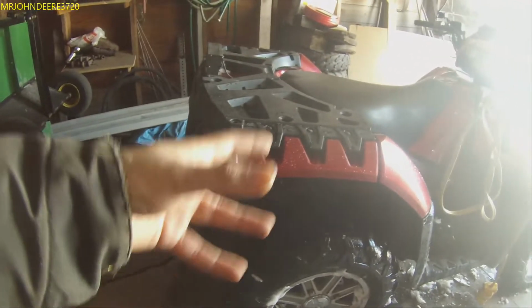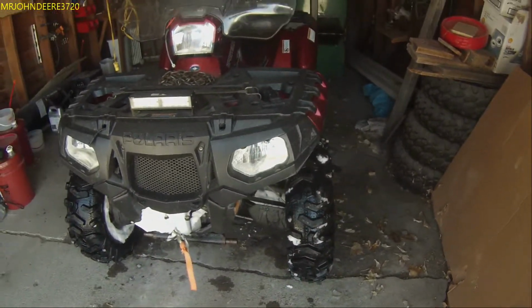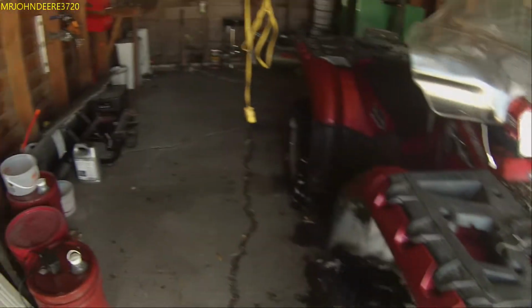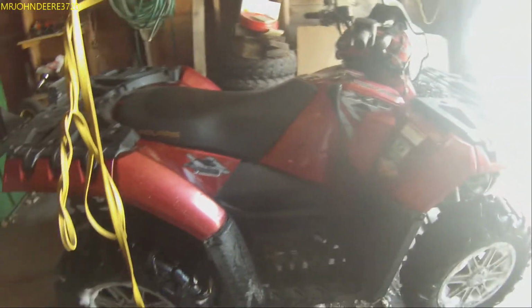This exhaust system, that's the newest problem. The ball joints are the oldest problem, because I think they've been out for a couple of years already. I just didn't notice it until last year, because I noticed how that tire is leaned out at the bottom, it's kicked out, and this one's just starting to do the same thing now too. So it's telling me that the ball joints are taking a shit on the lower side. Uppers are probably all right, but if you're going to replace one, you might as well do all four, so then you don't have to worry about it.